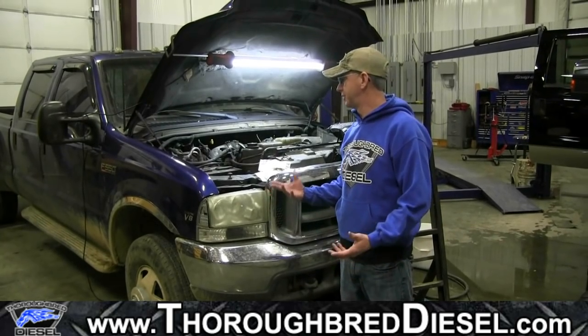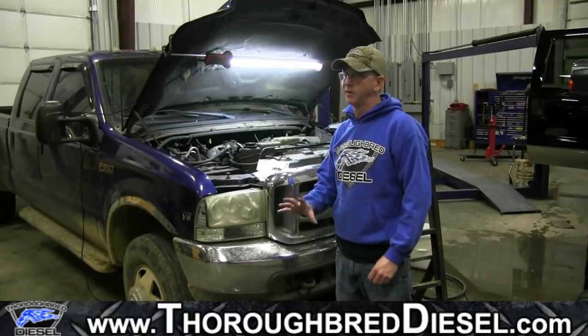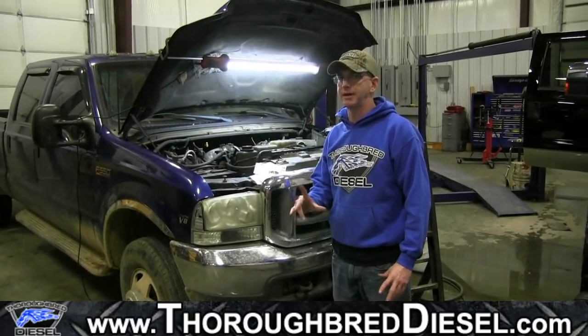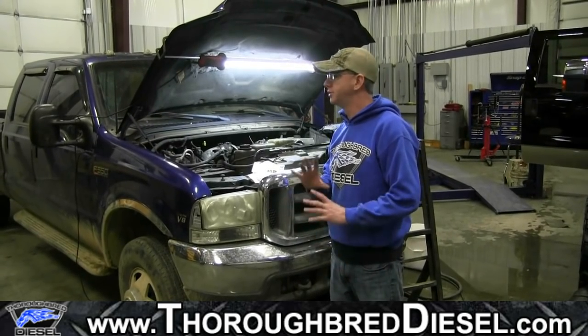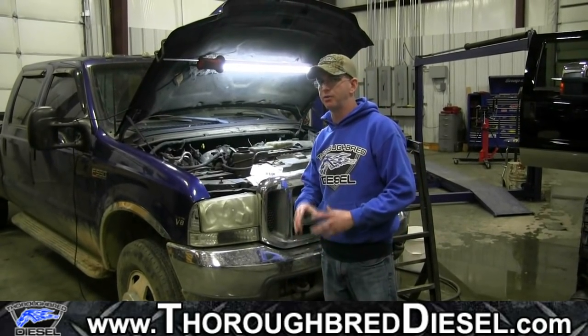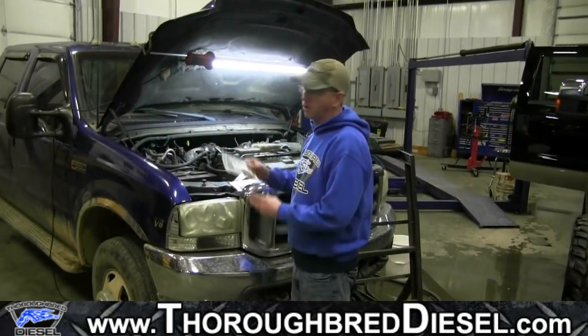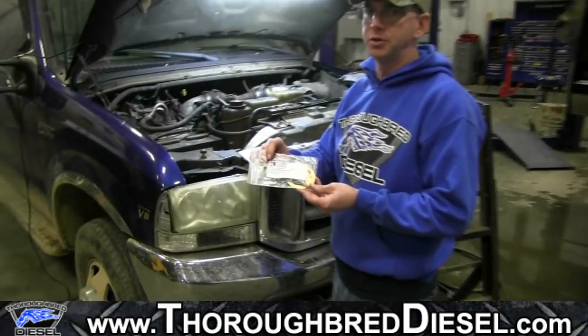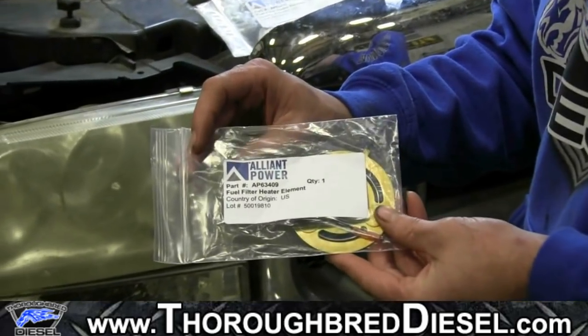What's good about this truck that we've got in here today is that this is an early 99 model truck. The early 99 model trucks can actually have two different style fuel bowl heater elements. That's a mouthful. Your early style, from your 94 to your early 99 trucks, is going to be an Alliant Power part number